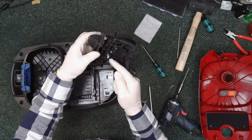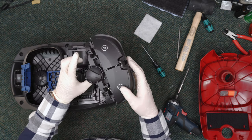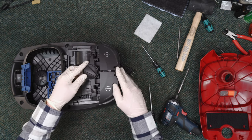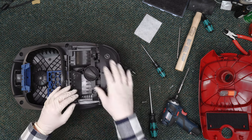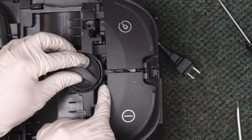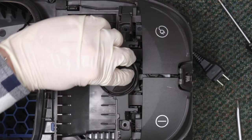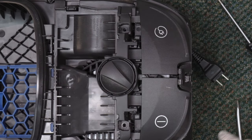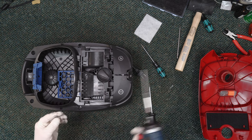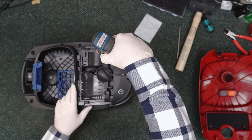This little piece is notched and fits down into here — that's what controls the motor speed. We want to make sure it's going the right direction, which it looks like it is. That's back down into place. You'll see this little white piece moving — it's high speed, low speed — and it does seem to be activating properly. We've got it aligned correctly; that's one of those tricky things with reassembly you wouldn't know just doing it for the first time.